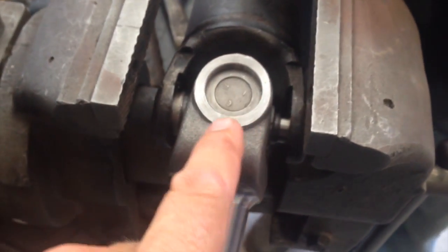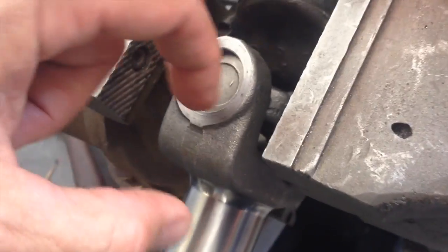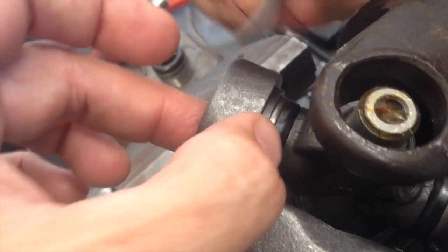And what happened was Joe pressed it in. And now there's a little ring, right? I already pushed this side in, and there's C clips that go in right there. Okay, the C clips are on the inside. And there they are, at the rear of the universal joint. And now he's putting in the ones that are going to connect it to the drive shaft.